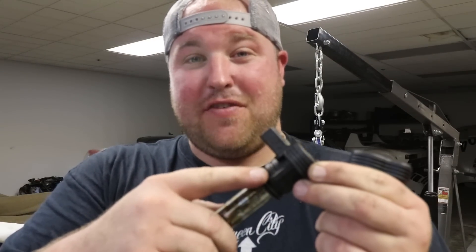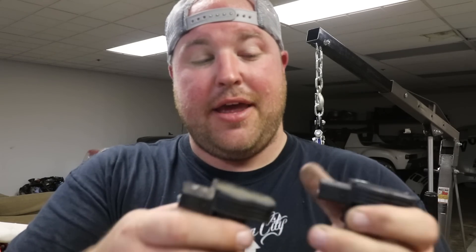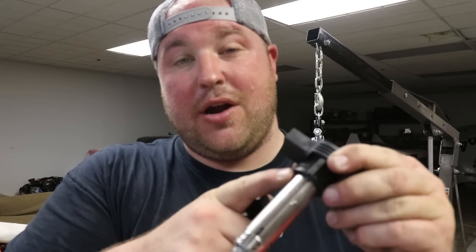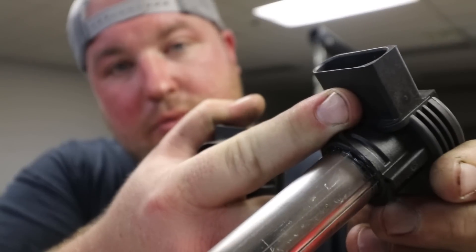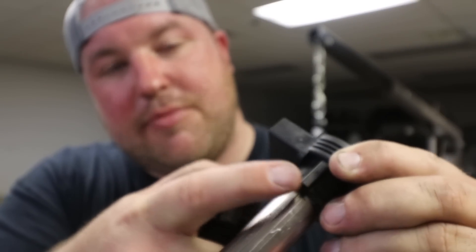I also want to install the coils to keep debris out of the spark plug holes. It took us a while to figure out, but because the valve cover is for an 07k and we have to use 180 coils in order to fit under the stock 944 hood without modifications, we actually have to take the boot off our factory 07k coils and install them onto the 180 coils, and trim to the hard plastic piece — which is basically right at the bottom. Then you get a perfect seal and the exact height needed. It's a little oddball but it works.